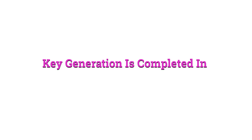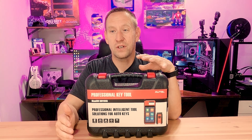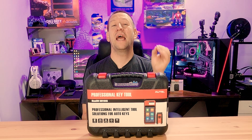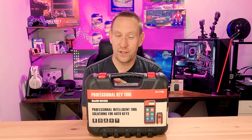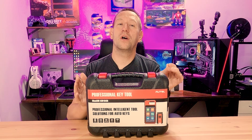Key generation is completed in 60 seconds with speed up by 50%. Now that speed-up measurement is comparing to the old days — for me that was using the CK100, which seemed to take forever, especially on vehicles with an ignition lockout sequence that would be 10 to 15, sometimes 30 minutes that you had to sit and wait for the security system bypass before it would let you program a new key. This tool does have the ability to bypass that in many cases, but not all cases. Some vehicles will program a lot faster.